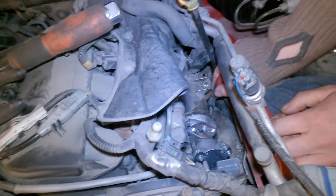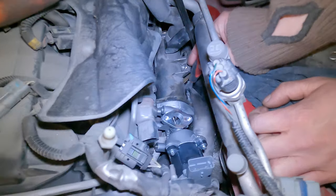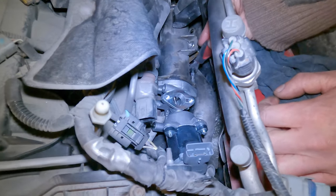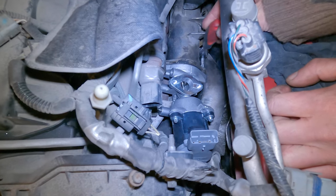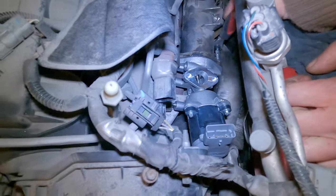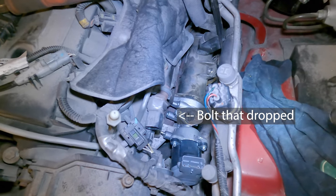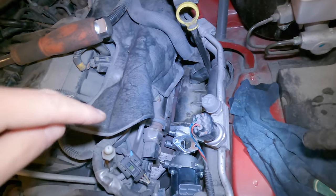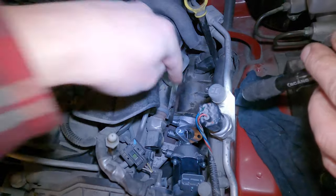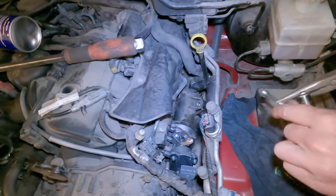Okay, so we decided to connect the cooler to the EGR valve and then see if we can get the bolts to enter into the block. Hopefully we put in the right bolt that needs to be in first. Yeah, so the EGR valve is mounted. Are these bolts fastened? Yep. That's finished, okay. So you only need to worry about getting that bolt in.